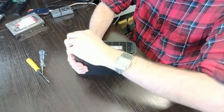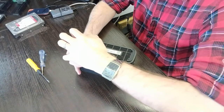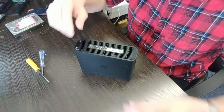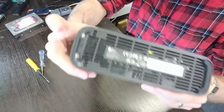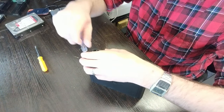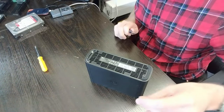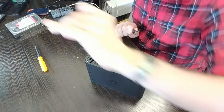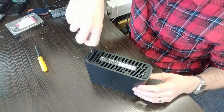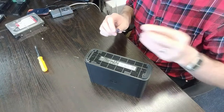Take your time. Rotate the device up and on the side that has the front LED, remove the rubber panel located there. That rubber panel will put up a real fight, but once removed it exposes two screws at the front — these are pretty much what keeps this three-part enclosure together. Make sure you do not mix these screws up or you'll end up tearing threads. Also, do not use any kind of electric screwdriver when doing this.